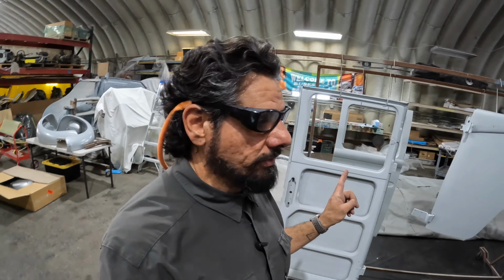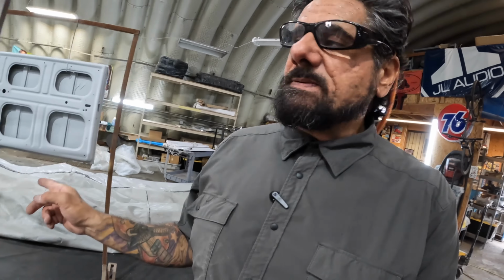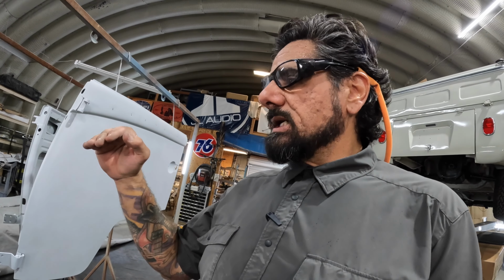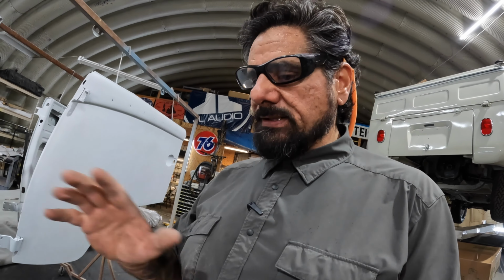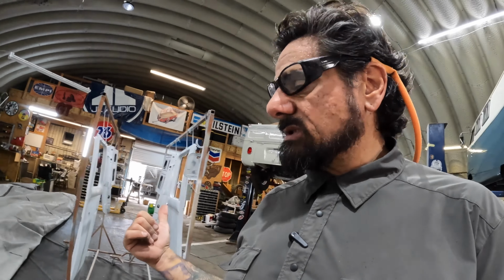But Ocean and I got the booth cleaned up top to bottom. We literally actually washed the top of the booth as well, just to make sure no issues. We will spray these panels here next week. I'm going to put them into a urethane sealer first, and then from the urethane sealer, I let it cure, and then I'm going to just block it with a 500 real quick, dry, and then we're going to be doing the base and clear on those.